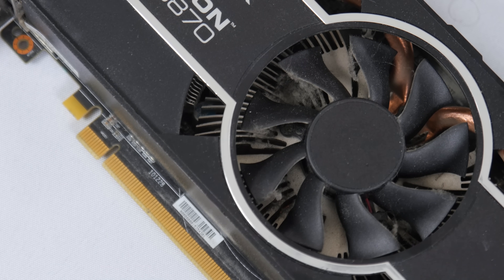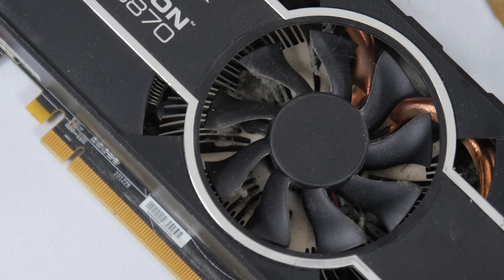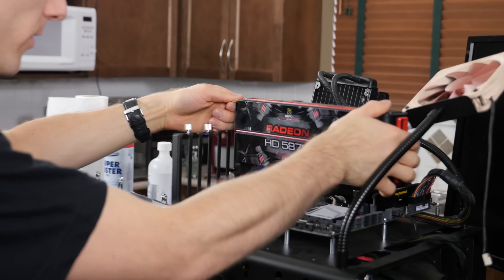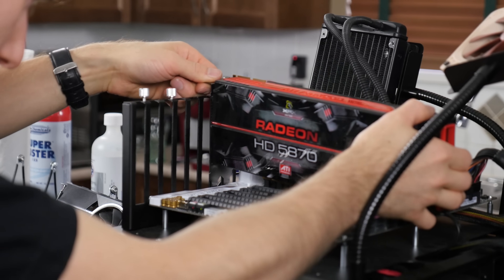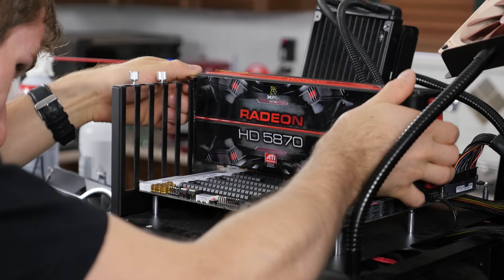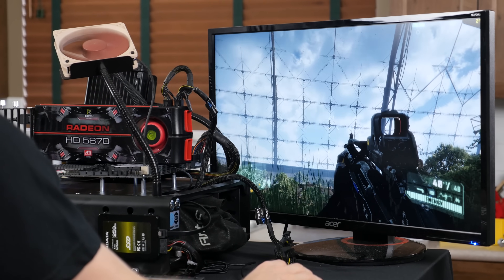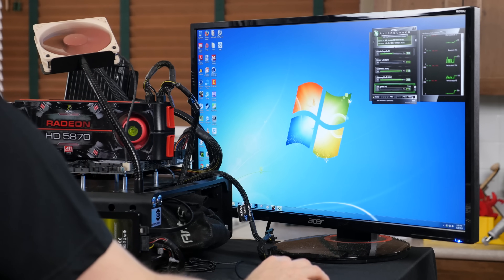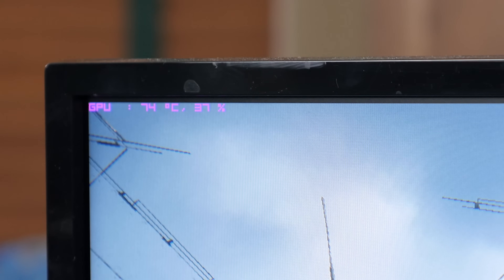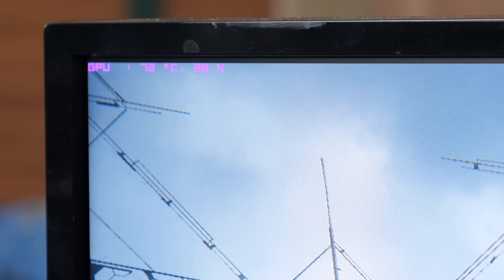since its design causes there to be a small, difficult-to-access potential bottleneck inside the shroud that can essentially prevent air from getting through the heat sink. By contrast, the 6870 has a very open cooler design that is both difficult to gunk up and easy to access for cleaning. So for step one, we need to get a baseline reading of how the card is doing. We used the SkyBox in Crysis 3, and then using MSI Afterburner, we loaded up the key performance metrics. GPU temperature and fan speed percentage — we ended up with values of 74 degrees at 39% fan speed at max.